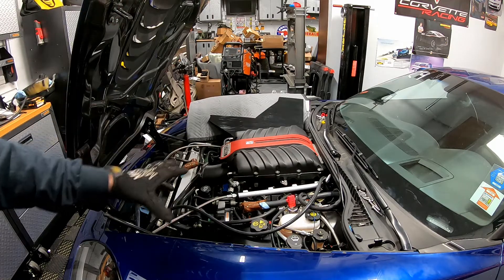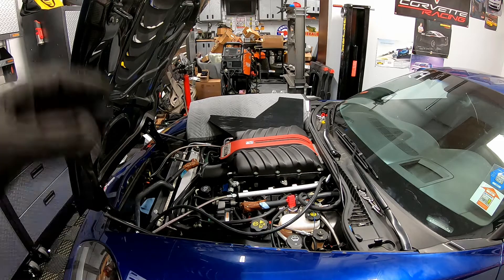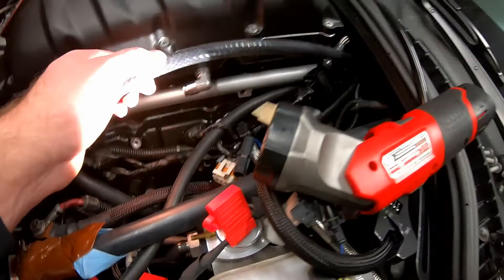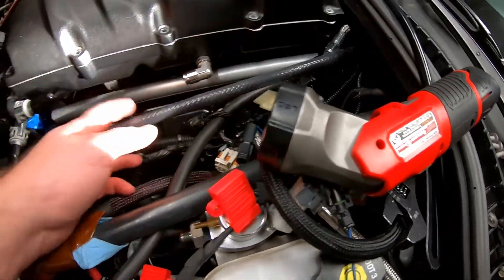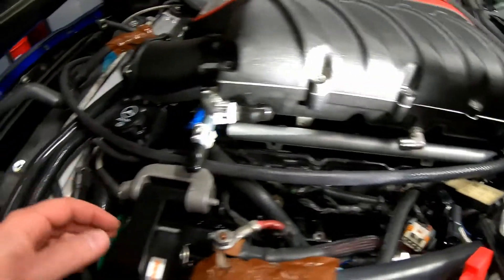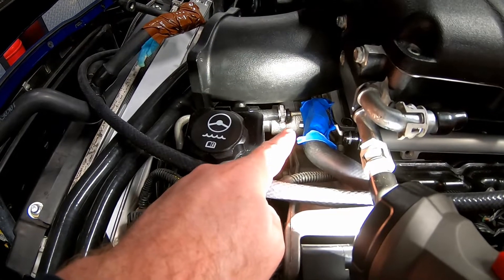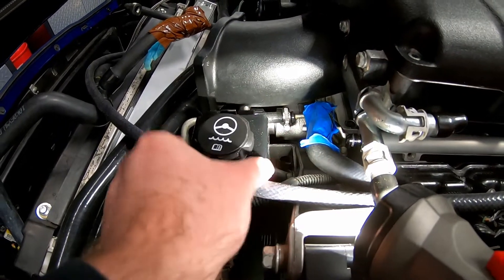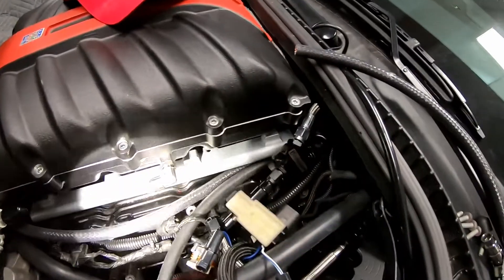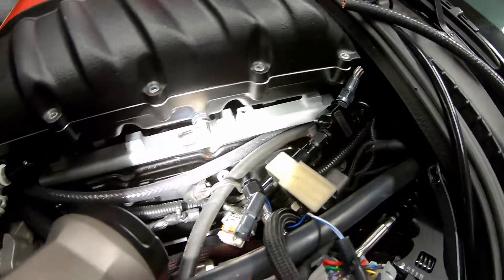The supercharger's back on the car — I just need to finagle it into its final place, then we'll be able to complete the steam port vent project. Here is the rear steam port vent hose. I wanted to make sure the fuel rail was in place — it's kind of mocked up right now, but if you can see down in here, you'll see where that hose clamp is. We're going to take that off, cut that hose, put a T-fitting in, and put our hose to that hose.